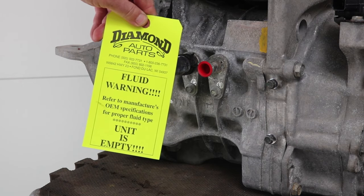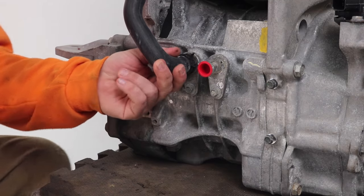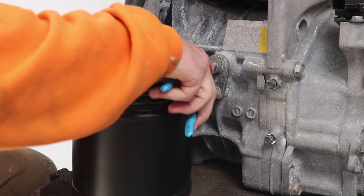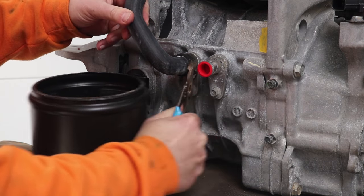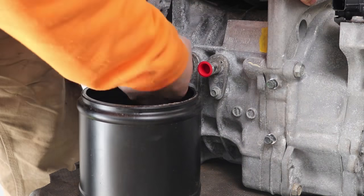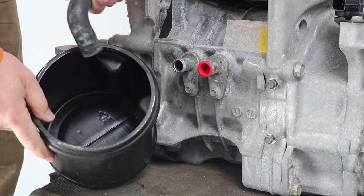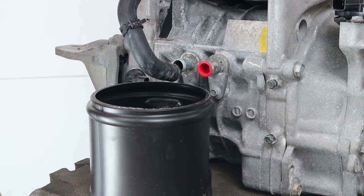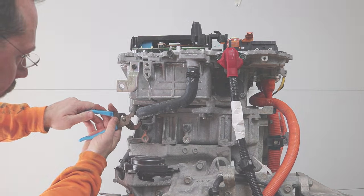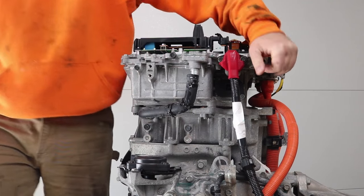The junkyard says they already drained this thing, but I just don't want to make a mess. So I'm going to disconnect this liquid cooling hose from down at the motor first, figuring that's the lowest point — if there is fluid in there, hopefully it'll all drain out right here, and then I can disconnect higher up at the charger and inverter. Looks like it's pretty well drained already, probably spilled all over my car when I brought it home. So I'm going to disconnect the coolant hose between the charger and the inverter — and that's got a little coolant left in it.